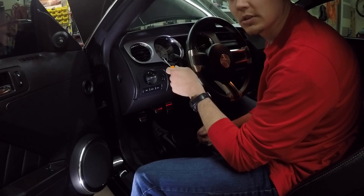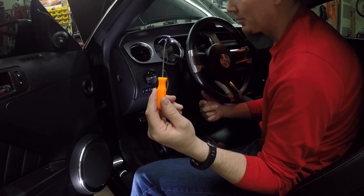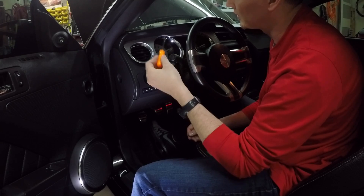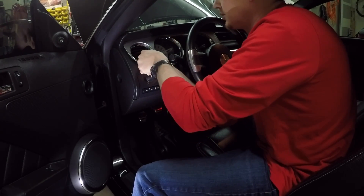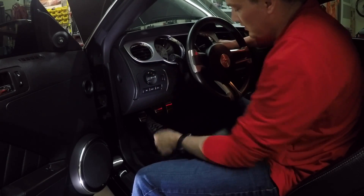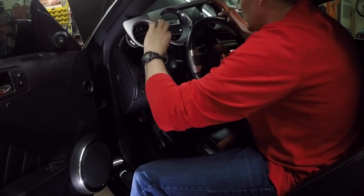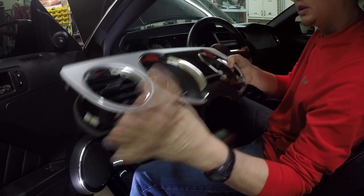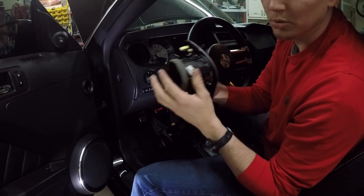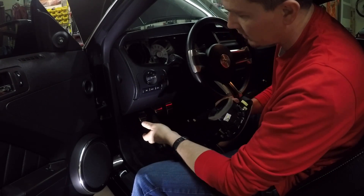Day two — installing the pod and everything. Pretty much just using this hook right here. I know everybody says you just pop it off, but it's not exactly something you can grab with your fingertips and pull off. I got this hooked in behind it and pull it out — makes it easier. So that's pretty much what I'm doing right now, popping it out. Once I've done that, everything should snap right on out. So that is out now. Now we just got to break all these tabs down to get this all apart to be able to put the Roush pod insert in here, and then we'll move on to doing the wiring side of it.